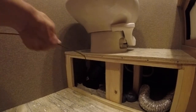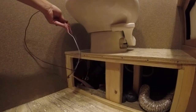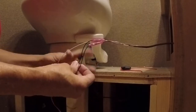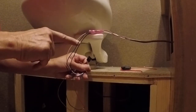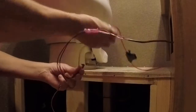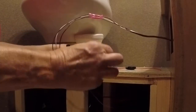We're fish taping and running our three strand wire. Here is what plugs into the monitor. We've fish taped our wire and got the first set of wires from the plug that goes into the back of the gauge. The white wire is the sensor power — that's the power that powers the sensors down on the tank. The black wire is the sensor ground. The blue wire is the signal that comes from the sensors to the gauge. You've got a couple left over: a red wire for hooking up to the ship's positive via the inline fuse, and the ship's negative. The orange wires are for an optional external alarm — it's a one amp connection — we won't be doing anything with that today.